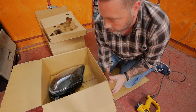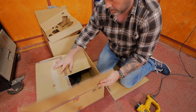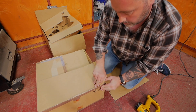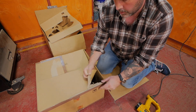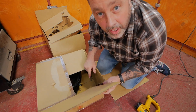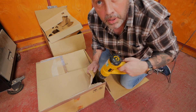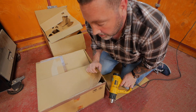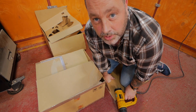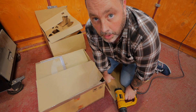Put the light in a box, close the box, make a little hole in a corner away from the light - because we don't want any direct heat going onto the light - and then just heat up the inside of the box. Give it a few minutes, have a feel, feel how hot the light is. Once it's really nice and warm then we can take it out and carefully start prising it apart.